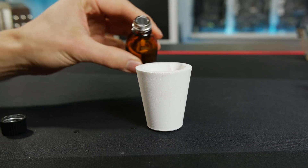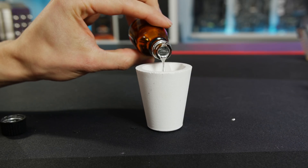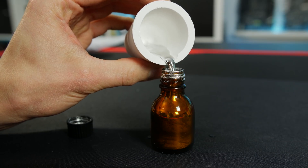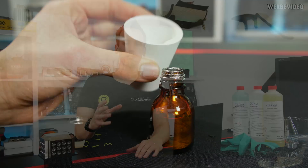Typically liquid metal contains gallium, indium, and often tin, because tin is much cheaper than gallium and indium and doesn't drastically change how liquid metal behaves — it lowers performance slightly but not significantly. Gallium and indium are the main metals forming alloys with bare copper. To prevent this, you need nickel plating to create a diffusion barrier between the liquid metal and the copper, so the gallium cannot corrode the copper.